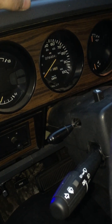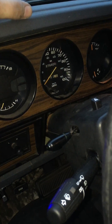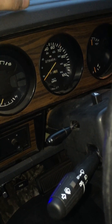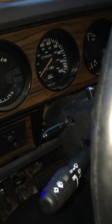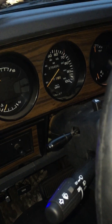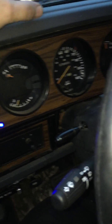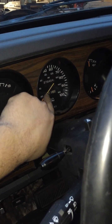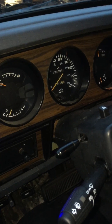When you pull out the speedometer, you'll see there are three little prongs — one's black, one's red, one's green. You just snip the green, put a butt connector, and splice it together. So that's all you need to do: run that gray wire from the orange and white wire into the cab, connect it to the green wire on your speedometer — that's your vehicle speed sensor pickup.